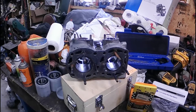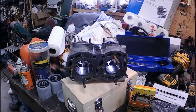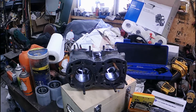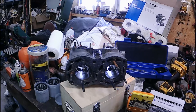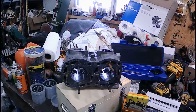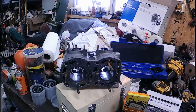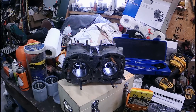That is 100% the root cause of the scattered skirt. If you have that much clearance, your piston is going to rock in the bore, and eventually the skirt is going to break up, go away, and go through the motor. I feel pretty good about this. I'll have to get these bored over — I believe I have a pair of half millimeter over pistons for it. I'm going to specify five to six thousandths clearance on this motor because it's a cast iron bore but it's liquid cooled. I have some experience with these motors, and I can tell you that if you set up a TXL at three or three and a half thousandths, you're probably going to scuff a piston at some point. More like four and a half to six, or five to six, is a much safer target on one of these motors.